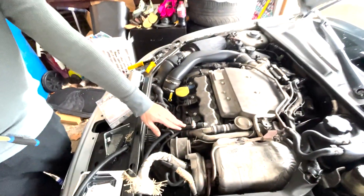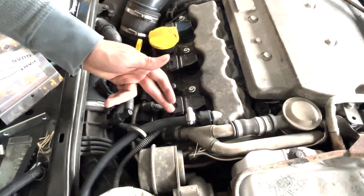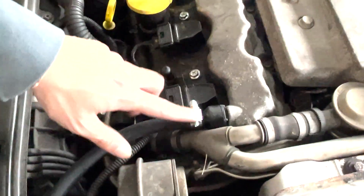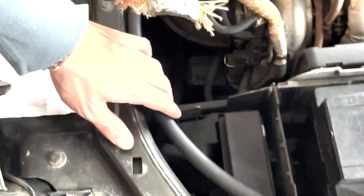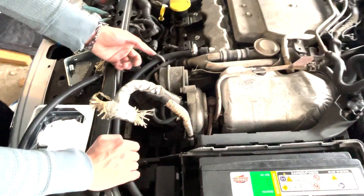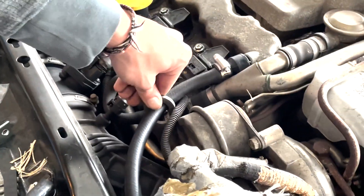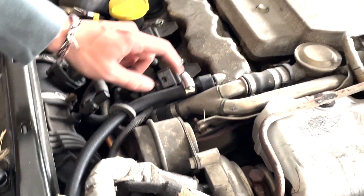We got the plastic hose off — I used a razor blade to cut through it so it didn't damage the nipple fitting down there. We got way more hose than we needed. This is a 3/8 power steering hose so it can hold up to the temperature of the turbo. Loop it through the engine bay, like the engine hoist mount, that way you don't put too much stress on the PCV hose or the PCV valve.